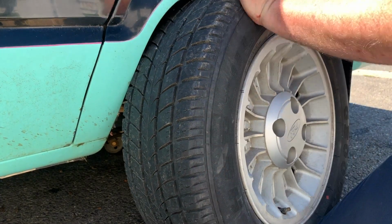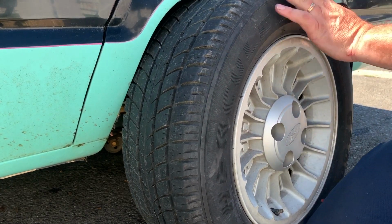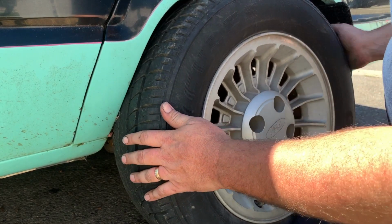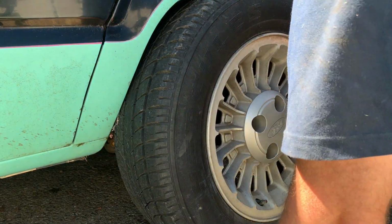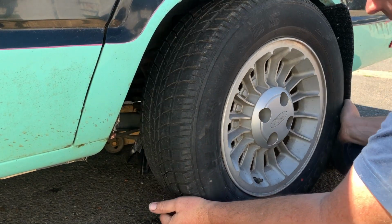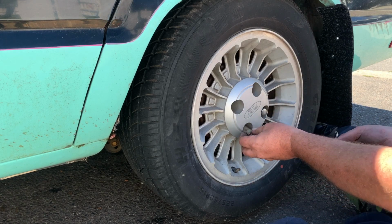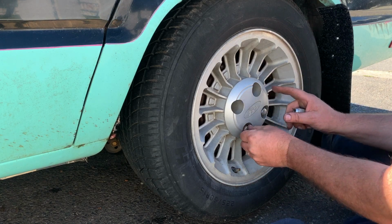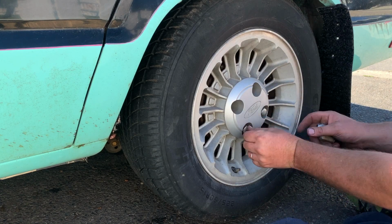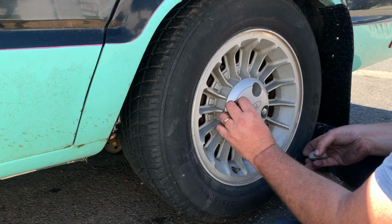I keep losing fluid, which should say to me it's a leak, but I don't see any puddles anywhere. I just don't know. So the rears have wheel cylinders. They're pretty buried. That's why I took the rears off. Took the rear wheels off, pulled the drums off, check the brakes. They all look pretty good.